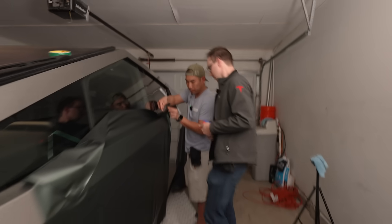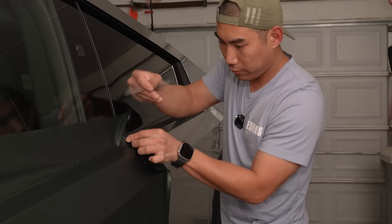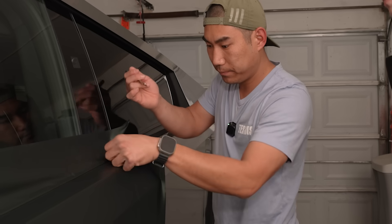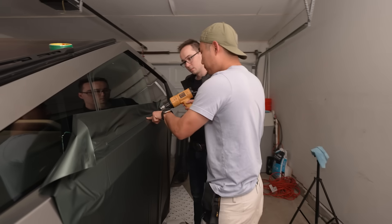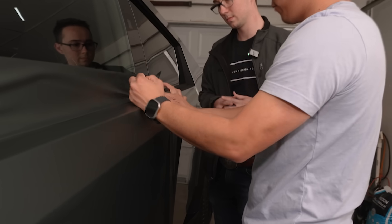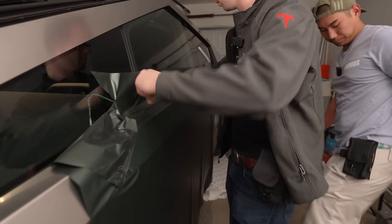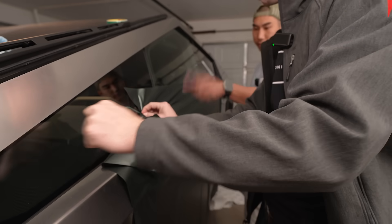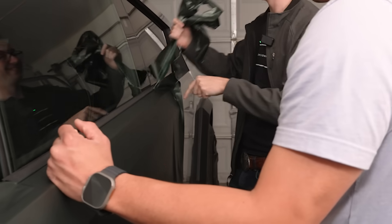When you get to this point you need to create an exit point. The vinyl tape is right here — I've created an exit point like that, and you can see all of it is on path exactly how we want it. Give it a little bit of heat. Get to the entrance, hold your finger, pull, and go all the way out right here, consistently. Then pull both sides of the tape together and pull the whole vinyl. That also releases the bottom side.